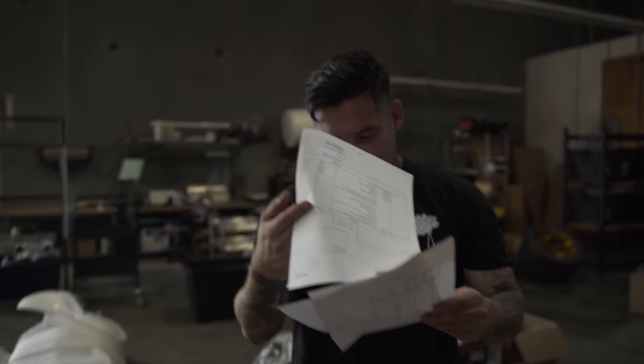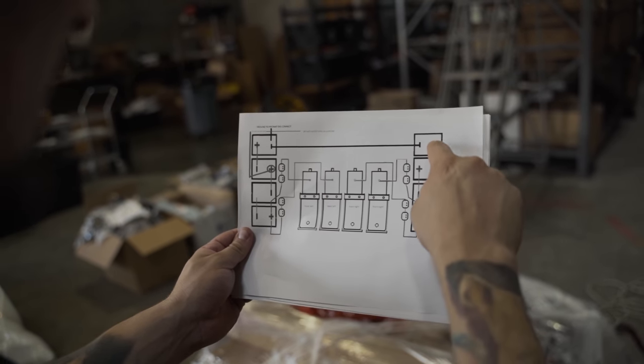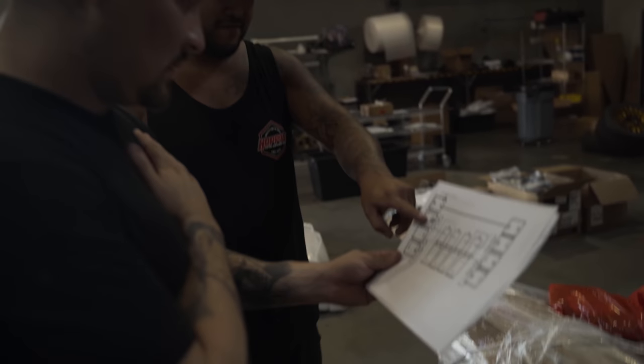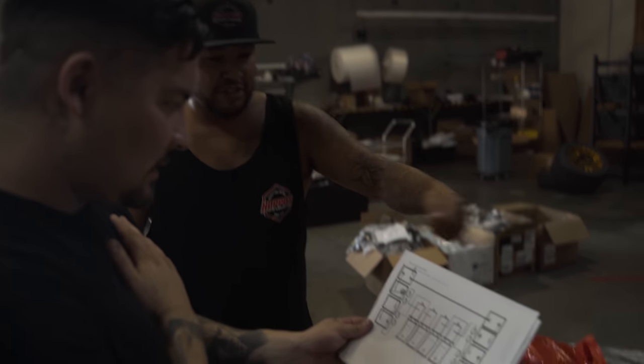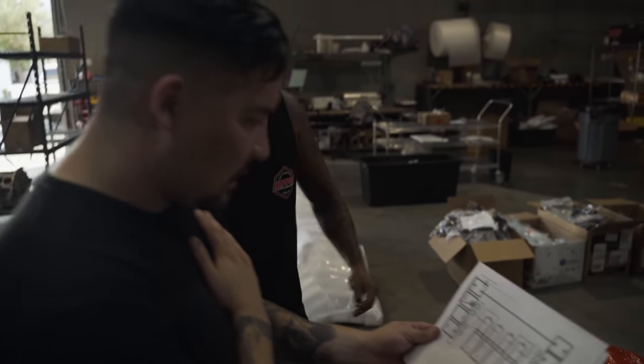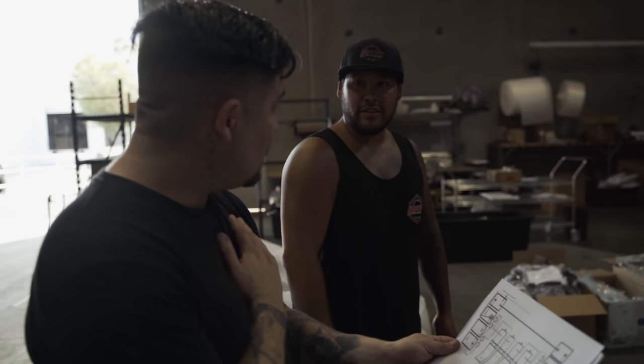Six figures — god damn. $4,500 — thank you brother, appreciate it. So this is a wireless command, it's automatic. He gives us two weeks — challenge accepted. So battery, battery, battery, battery — alternating. The positive goes to negative, positive goes to negative — we're all 24 volt. So everything's gonna trigger off your 24 right here. We're sharing the ground here — this would be like your left bank, that would be your right bank. So you're just sharing your ground, so when you do your quick disconnect it kills all power.